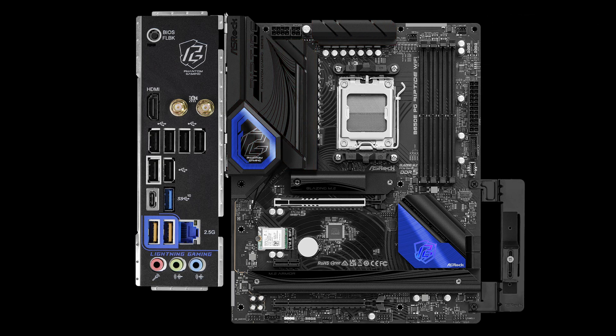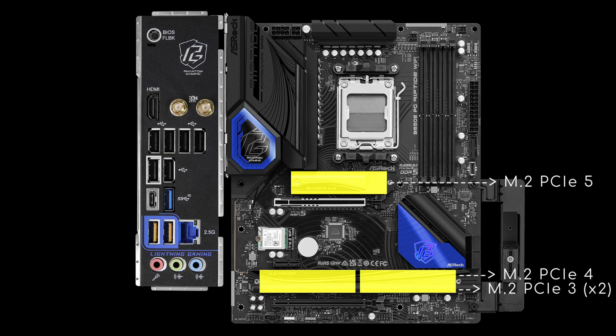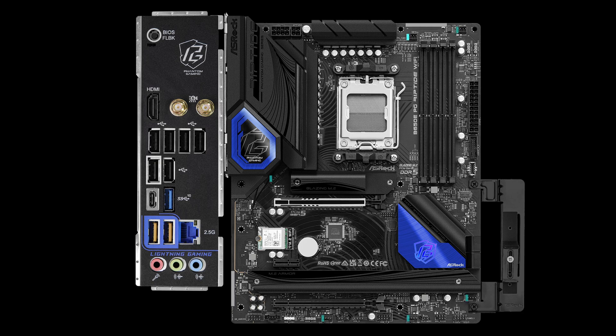These stages should be all rated for up to 60A and cooled by two separate chunky heatsinks. Moving on to the expansion slots: there's a reinforced PCIe 5 x16, a PCIe 4 x1, and a PCIe 3 x16 wired to four lanes. Above the first and last slots are one M.2 PCIe 5 socket and one Gen 4 plus one Gen 3 x2 respectively, all equipped with heatsinks. In the usual spot on the right, we can see four SATA ports and an anti-sag bracket. As for the internal headers, it has six fan headers — five of which support 2A — four RGB headers, three of which addressable, one USB 2, one USB 3.2 Gen 1, one USB 3.2 Gen 2x2 Type-C, and one for a Thunderbolt 4 add-in card.